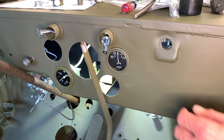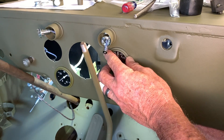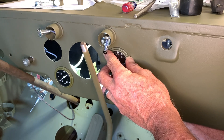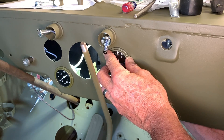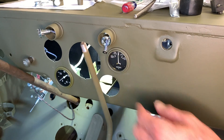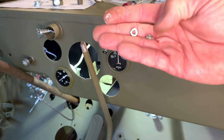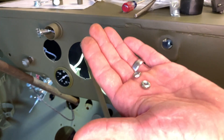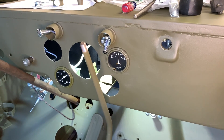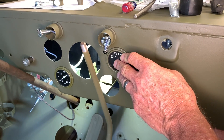I'm going to reach under the dashboard with my right arm and put the bracket on — the legs of the bracket are facing towards the dashboard. I also want to install the circuit breakers onto that bracket visible through the speedometer hole. For now I'll hand-tighten these and tighten them up properly when I get underneath to lay down on the floor. On the ammeter there are three nuts per stud plus a lock washer — we'll cover those fasteners in detail in the wiring series.